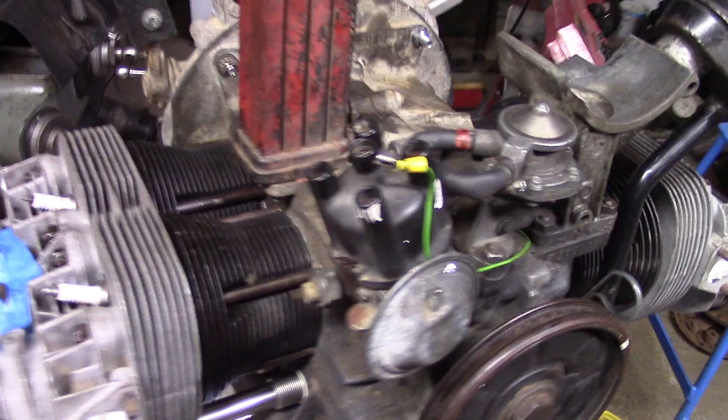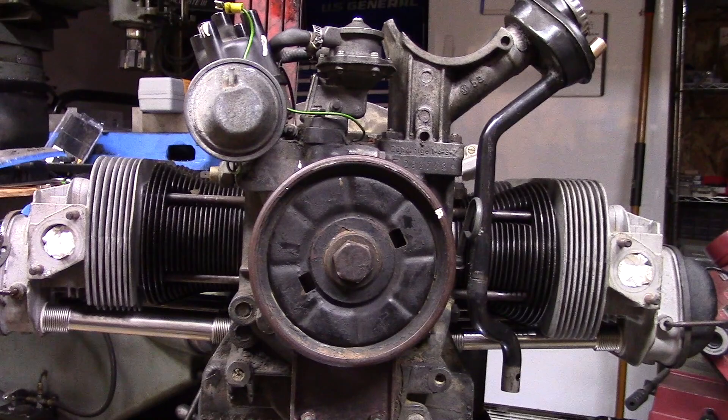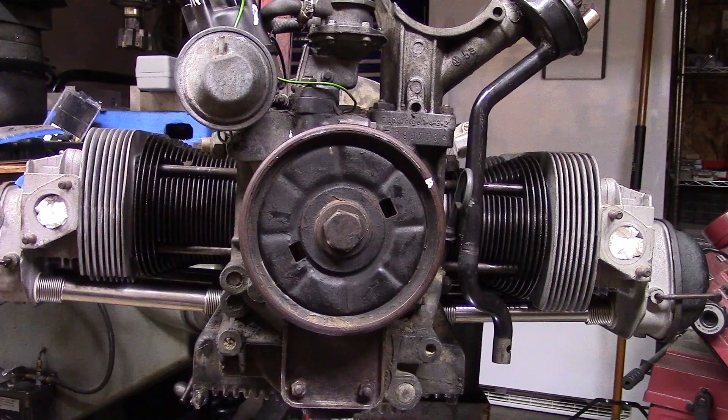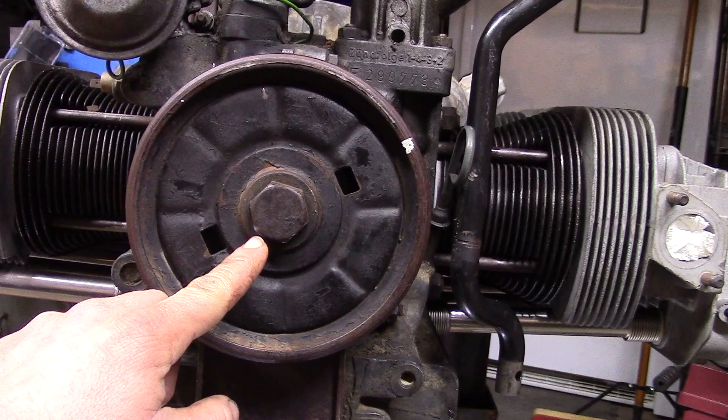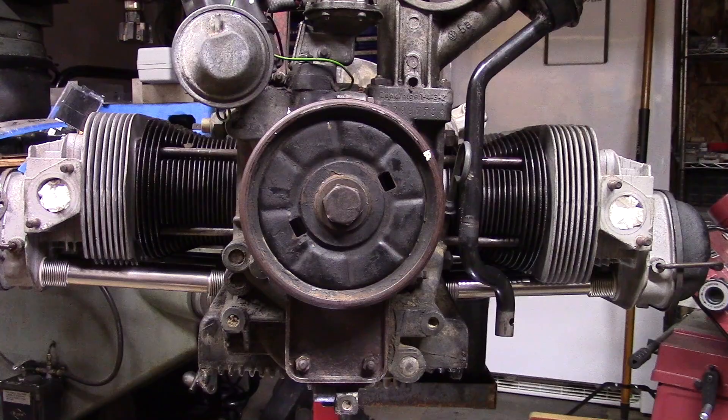I'm continuing to work on my buggy motor — the one I fabricated the heat riser exhaust system for. You might want to check that video out; I'll put the link in the description. This was the motor that came with the pipe frame buggy I bought and have been working on for about six to eight months. It was originally a 1600cc single port. When I got it, it was completely seized — they broke it free with a big wrench. You can see on the crank pulley nut that they rounded it off when they freed it up. It had really low compression and a lot of problems, but it was good enough for my buggy and I drove it around all summer.